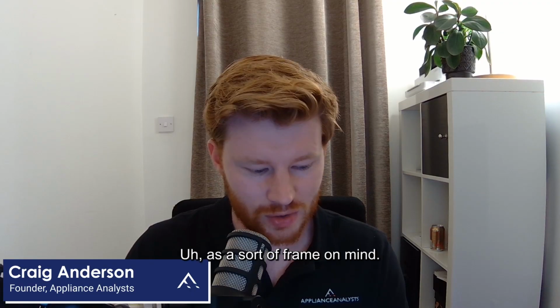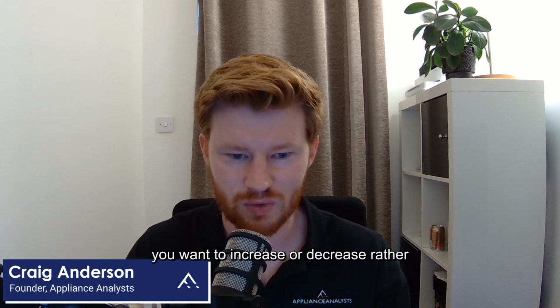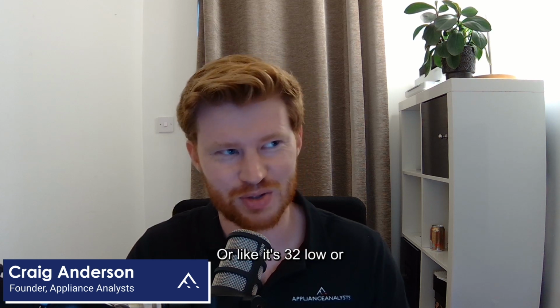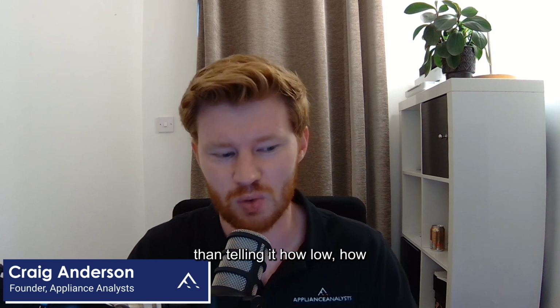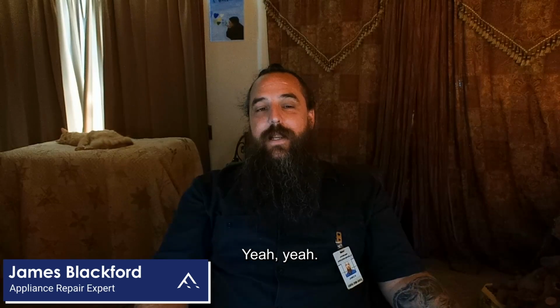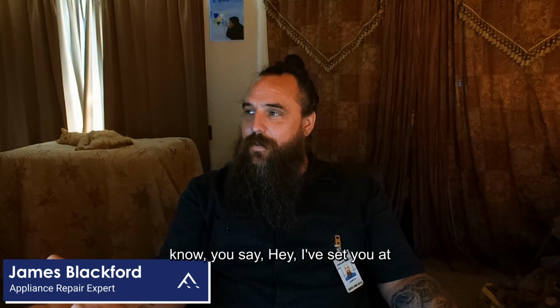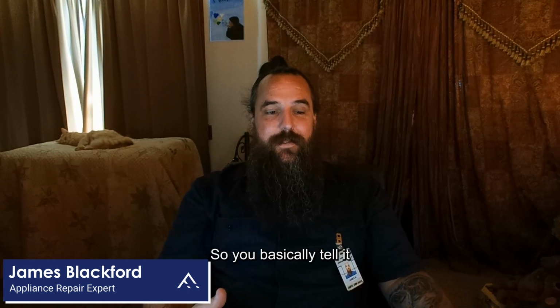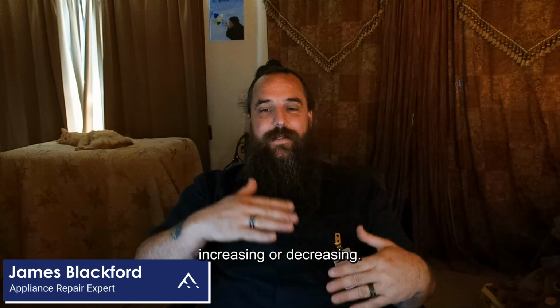As a way to frame it in your mind, it's the temperature adjustment that you want to increase or decrease, rather than saying it's 32 low or something like that. Right, you're adding to what it is rather than telling it how much it's missing by. You're basically saying, hey, I've set you at 350, but you're really 320, but it thinks it's 350. So you basically tell it, here is 350. This is what's accurate, by increasing or decreasing.